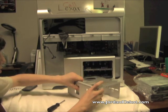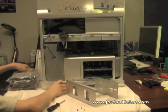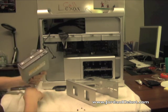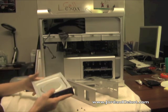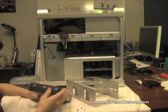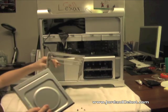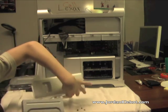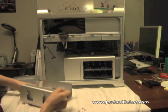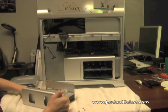I have two new drives I ordered from Newegg.com — they're LG DVD burners. I have an LG external burner and that works pretty good, so I trusted the internal ones. Any regular burner should work, even though it does have these fancy slots, because it just triggers a piece that will push the button causing that to open. As long as it's the IDE ports on the back, you're good to go. So, go ahead and line that up and slide it onto the drive. It will line up with the holes.